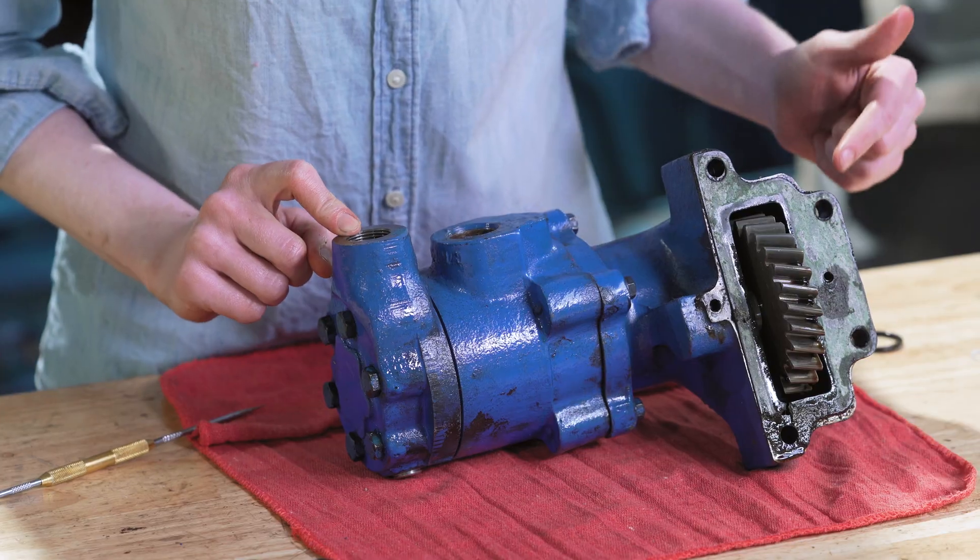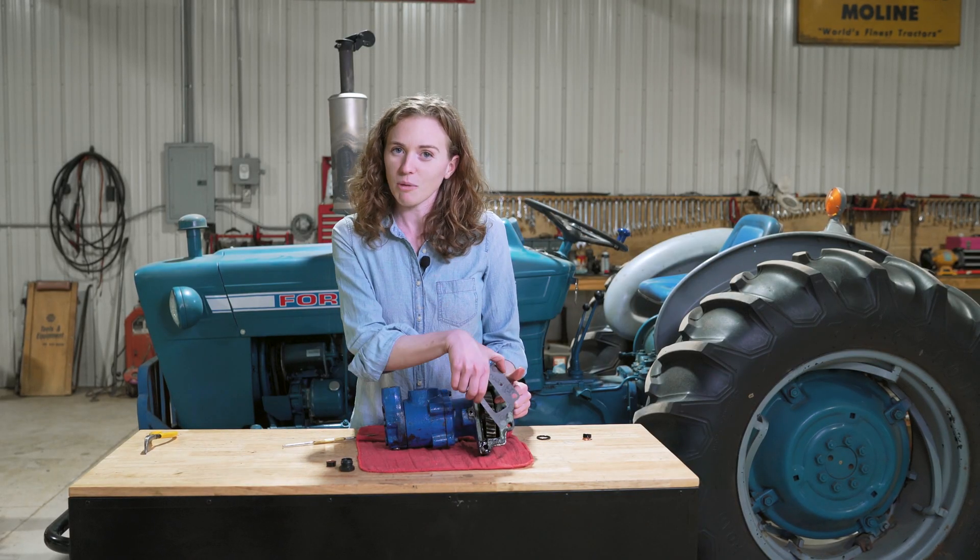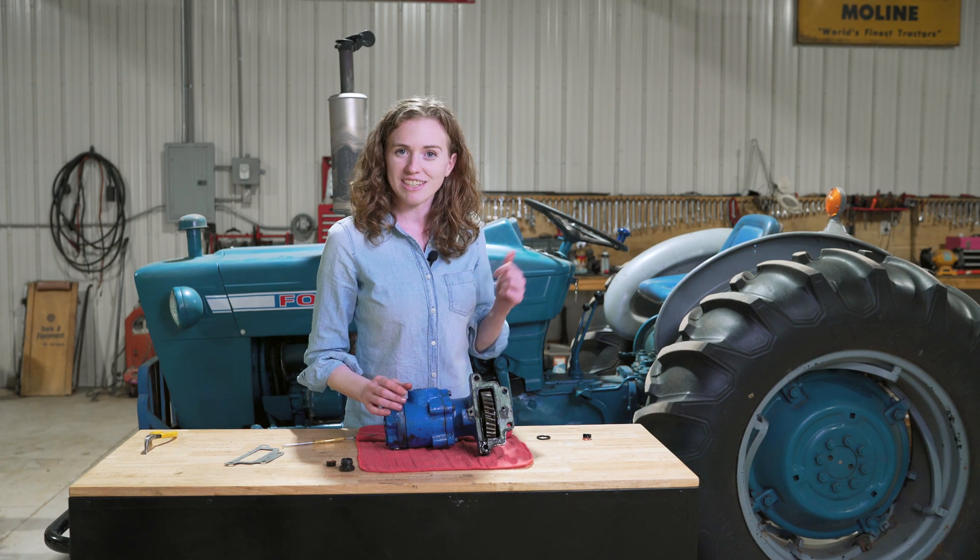On the bench you need to get the brass washer in the right direction, the nylon, and your o-ring — then you'll be ready. I'm going to take a minute to clean off the remains of my old gasket, use some gasket sealer, install my new gasket, and then we'll be ready to wrestle this onto the tractor.